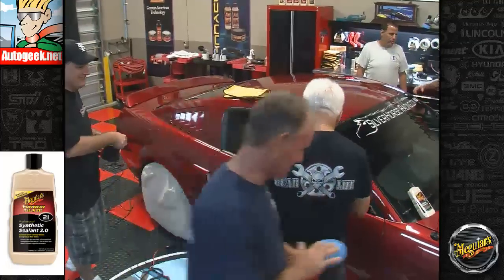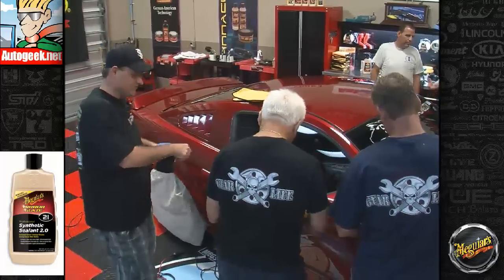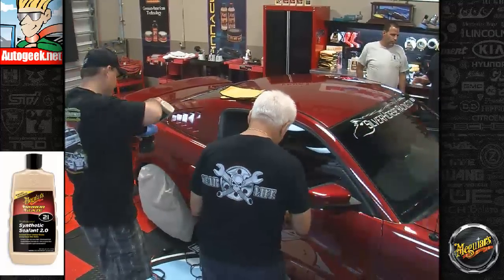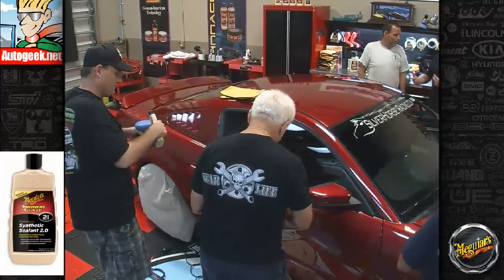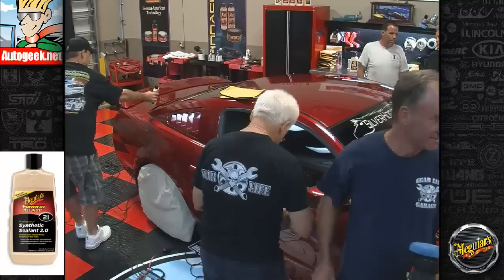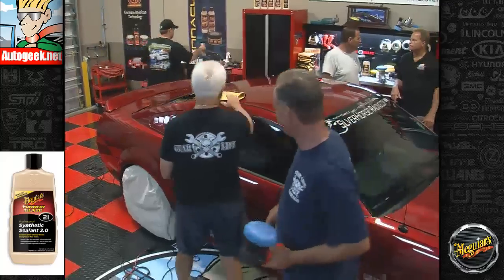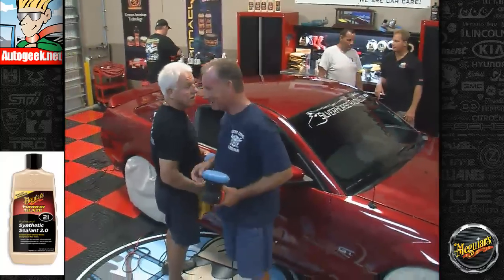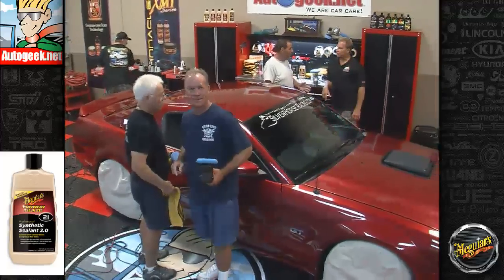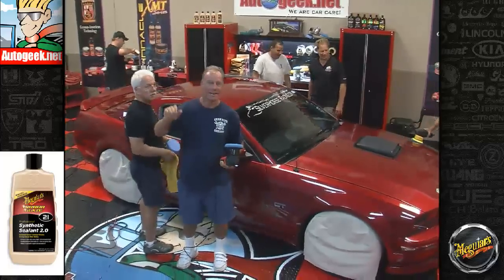I know you already know this, I'm just kind of talking out loud, but everybody brings their own unique way of detailing a car. What I try to show everybody is everything they can do, and then they can pick and choose what they want to do. Little things like dabbing the pad on the glass, they don't have to do that. They can just add more wax if they want to. Well, when I use 845, I do, because I put it on so thin I don't even know if it's on. And that's important, to put that wax on thin, because it's a bear to wipe off. It sure is. If you get too much on, taking it off isn't the problem. It's continually wiping it off, which bleeds back out.